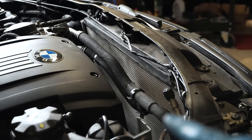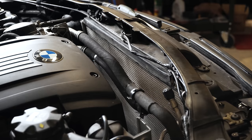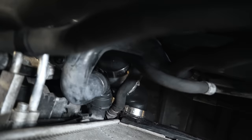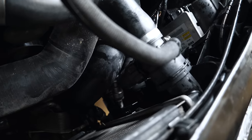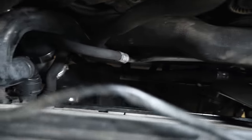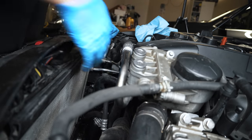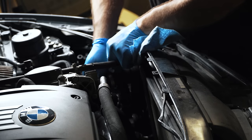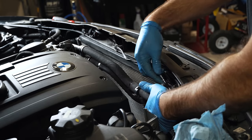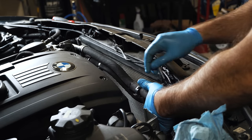Just be prepared for that to fight you the whole way up — it's kind of typical. I have aftermarket inlets, so it kind of binds up against everything. Now rather than dropping the intercooler, I'm going to try disconnecting the lower rad hose to drain it, as well as the upper rad hose after that has drained, and see if you can just get it out from the top without messing with the intercooler from down below. You just have to undo the clip on the radiator hose — expect a lot to come out. In the corners, there's two T25 Torx holding the radiator and AC condenser together.